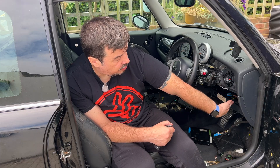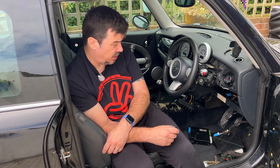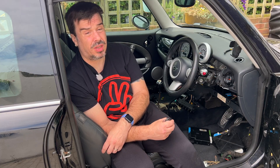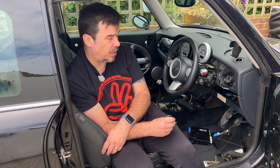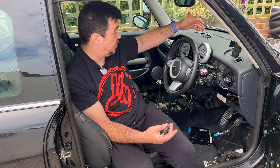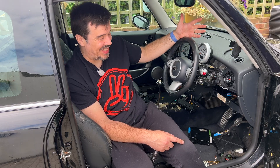It could have been tucked right up in the dash somewhere and that would have been really hard to find without ripping stuff out - and that's what a lot of this was. Once you know it's on the KBUS the voltage should be 12 volts - if it's less than 12 volts you know you've got a problem. Finding a short is then all traceable, but it's getting to these junctions to know what you're looking for. I've got a back-to-functioning Mini, though I still have two problems: one the airbag warning I've created, and two the traction control issue - and of course this entire dash has to go back together somehow.